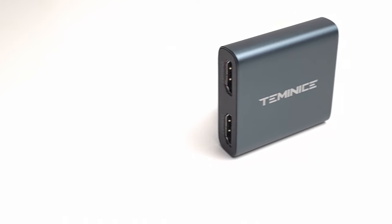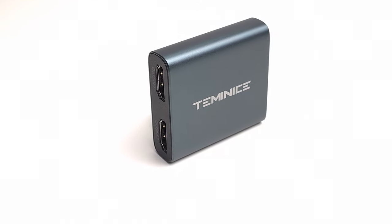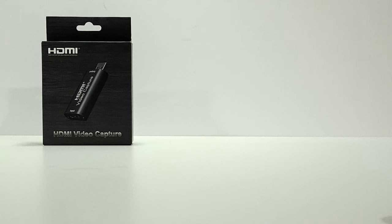As I like to view what I'm playing on a large TV and have what I see streamed to the PC, I'm going to need a little bit of an extra piece of kit for that. I've got an HDMI splitter, which can be purchased quite cheaply. That sits in between the console and the capture card, allowing the HDMI signal to be split into two outputs rather than one — so I've got a picture going from the console to both the capture card and to the TV. So let's go and see this video capture card in action.